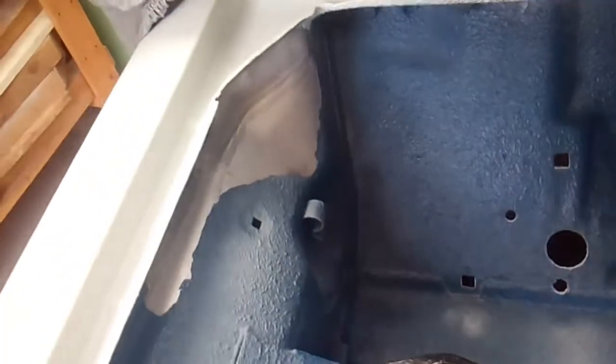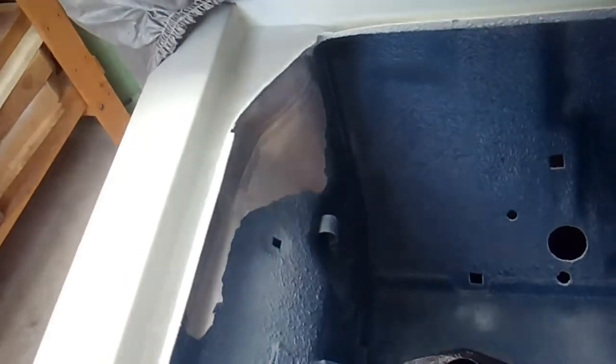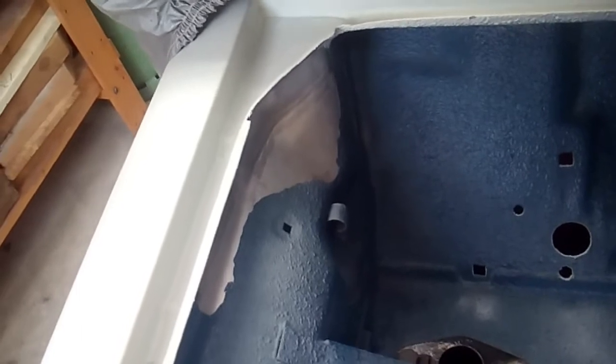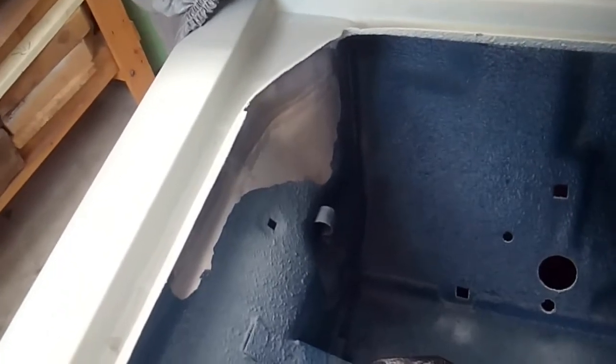There's a couple of wee bits in the... Maybe I can show you. Hold on. On the Mini. There we go. There's this bit here. Can you see this in the corner? Yeah. Where all the U-Pol stripped off, all cracked, because dummy here forgot to cover it with normal polyurethane primer.